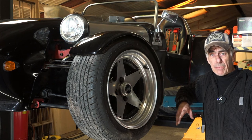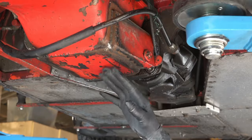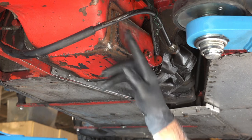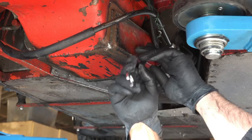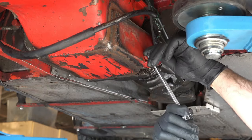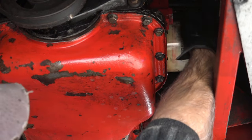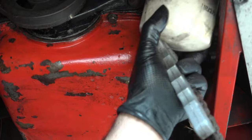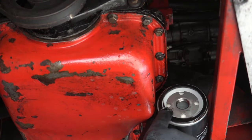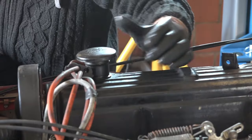Starting an engine that has been sitting for 10 years is not a good idea without doing some checks. First thing is to get rid of the old oil in the engine — remove the drain plug and double check it. Often it's magnetic, so if you see a lot of metal debris on it then the engine has a lot of wear and tear. At the same time we're going to replace the oil filter, which in most cases will be all clogged up, and then give it some fresh engine oil.